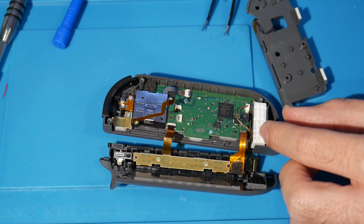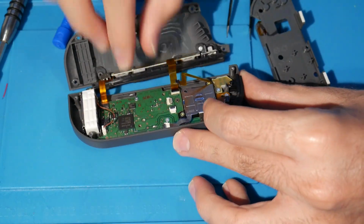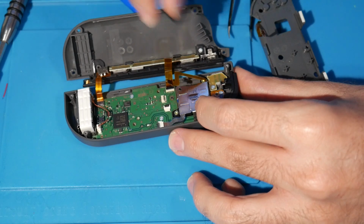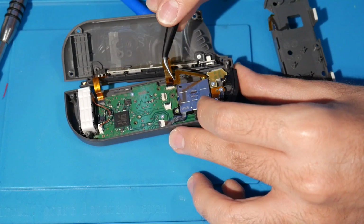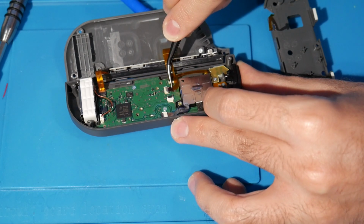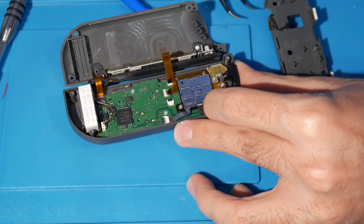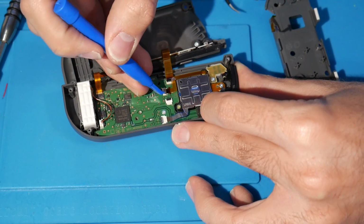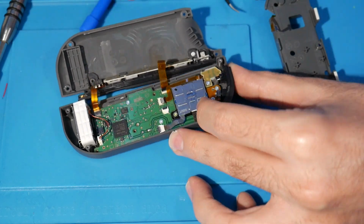And I would say at this point, we can go ahead and get this popped back in. So I'm going to make sure these are opened up, ready for loading. And I'm going to use our tweezers here. Just bring this in. You want to load it up like that. There you go. So once you have it loaded in, there should be a line that's meeting right there. You should be able to see that, at least when you're doing this in front of you. And close that up, and you're all good.